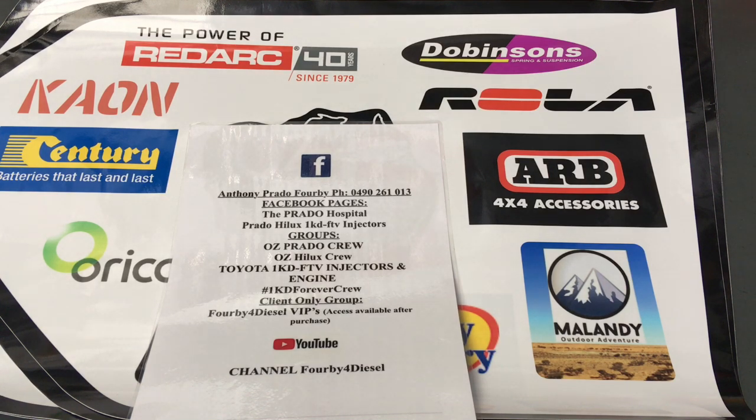People are going to ask which oil — certainly not the same oil you use in a 1KD. You need something specifically designed for a vehicle with a DPF filter, otherwise you're going to cause problems. They prefer thinner lighter type oils — they say they prefer a 0W30, a 5W30 is okay. But you can't just look at the first few words of the guide; you've got to read right into it. It says an oil with a higher viscosity may be better suited if the vehicle is operated at high speeds or under extreme load conditions. They might recommend a 0W30 for a new engine, but when the engine gets older or if it's used up north in hotter temperatures, long highway driving, or loaded towing, it's going to need possibly a thicker oil.